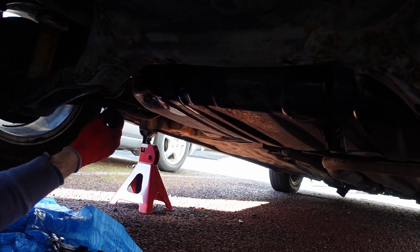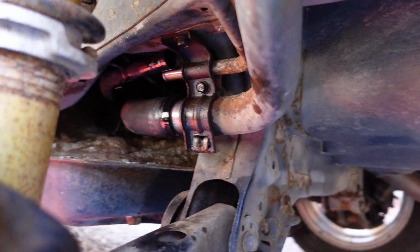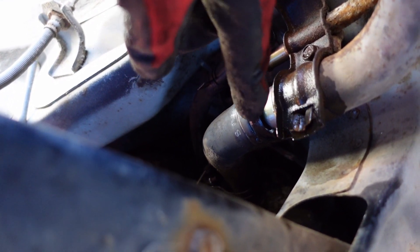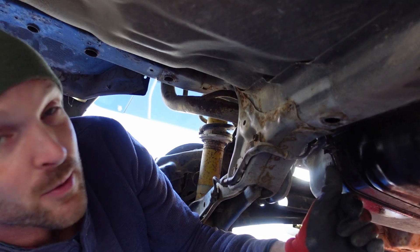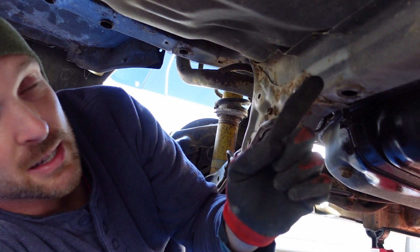You didn't miss anything — I just worked on getting the hoses from the fuel filter pipe down to the tank. Just a little bit of lube and some prying with the big screwdriver, trying not to mess the hoses up. Got it to slip free, so the vent line is off and the fill one is loose — I think when I drop the tank it's just gonna slide off. That strap's broken so the tank is loose; once this side breaks, the whole tank's gonna come down. Everything on the inside is disconnected, we should be good to go to drop the tank.